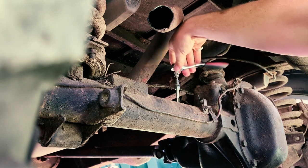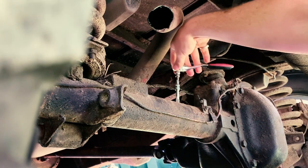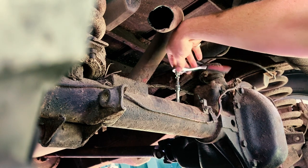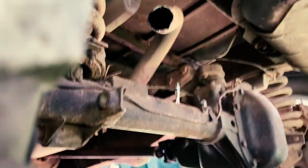Unfortunately the dirt from the thread being cut out here is going to go into the axle and start to contaminate the oil, which is fresh. So it's unfortunately going to have to be changed. That's loosened up nicely - great, I'm really happy with that. This little tool has done the trick.